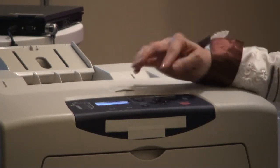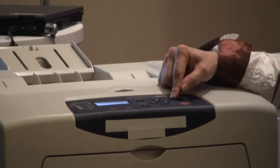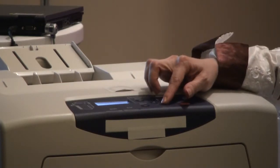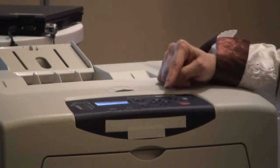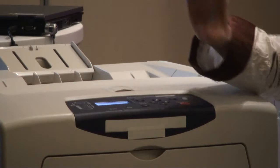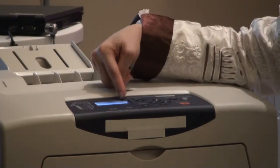Now I know. Maybe this button will help me. So instead of saying okay, I say eject. And it says replace toner — it says cyan. If I want magenta, I move down. Yellow. Black. Let me start with magenta. So it says replace toner magenta. So I say eject. You hear the sound? So the four toners are arranged like this, and it's moving magenta up to the top. And it says please replace magenta toner. So I open up.